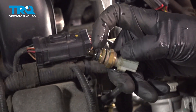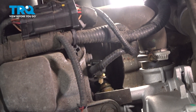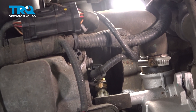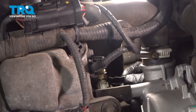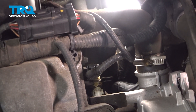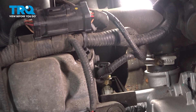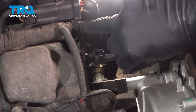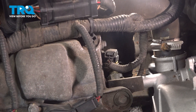Take the new sensor — you can put a little bit of coolant on the O-ring just to lubricate it, then slide it into the hole. Get that lined up so the connector is oriented similarly to how it was when you disconnected it. Take the clip, line that up, and use the needle-nose pliers so you don't drop it, and just push it in. Take the connector, line it up, and lock it down.